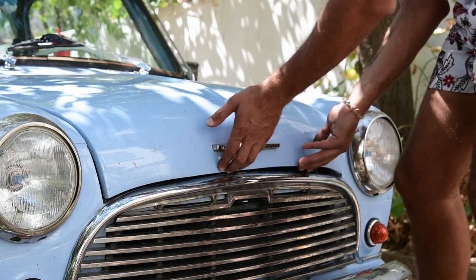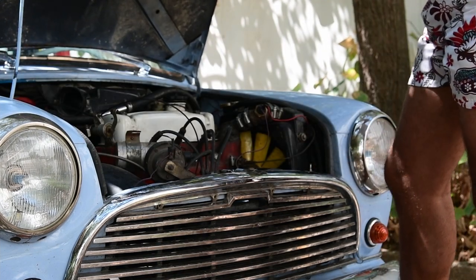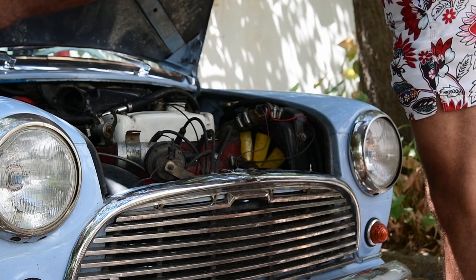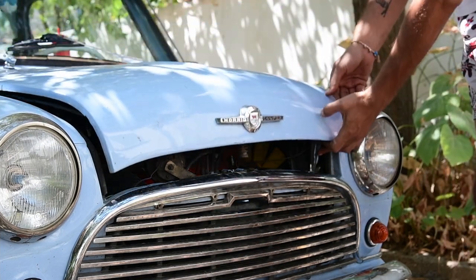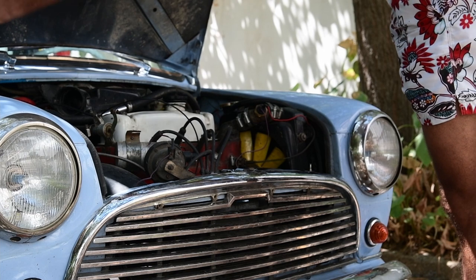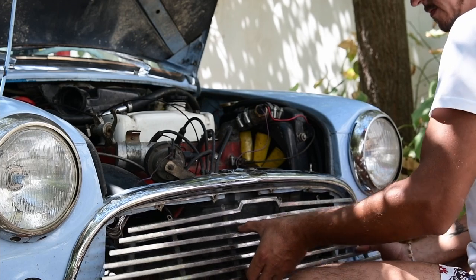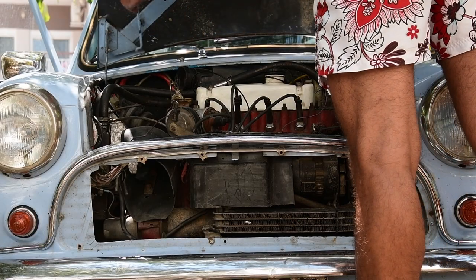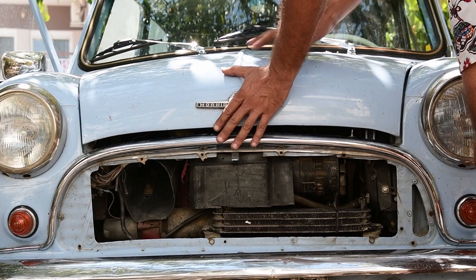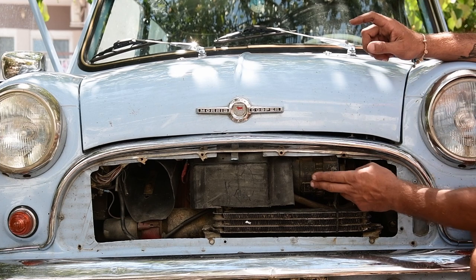Air availability to the radiator is further impeded by where the radiator is situated within the engine bay. 50% of the height of that radiator sits right behind the bonnet, which means with the hood down air just doesn't get to the radiator directly. It's worth mentioning that despite the fact that the cooling system of a classic Mini is a very well designed one, it's good for moderate climates really — because when the temperature is flirting around the 45 degree centigrade mark, things do tend to get hot.